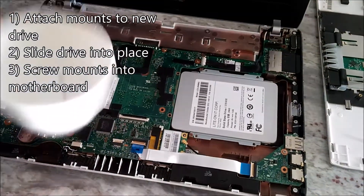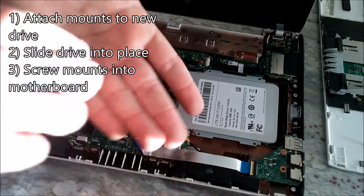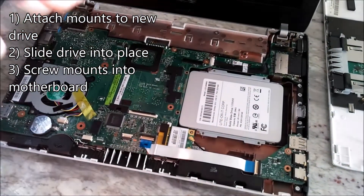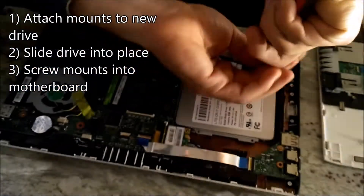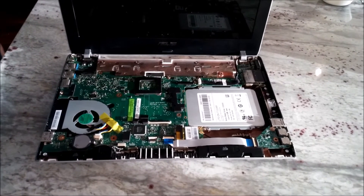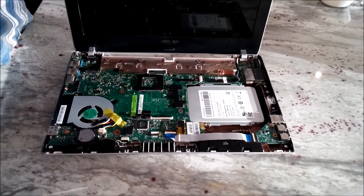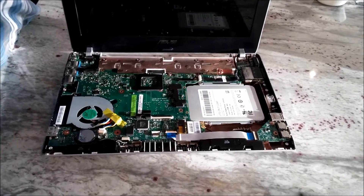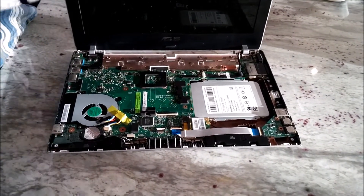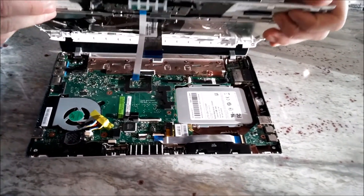We will get our two tiny screws back and reattach. Part three is reattaching the keyboard to the case — putting it all together again. The first step is the most tricky part of this whole process: you will be reattaching the ribbons to the motherboard.